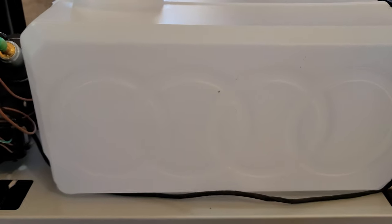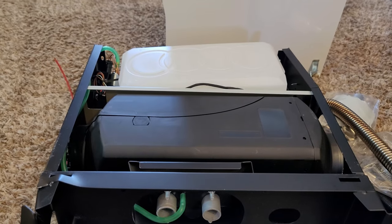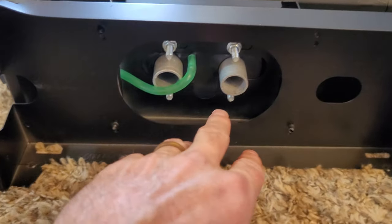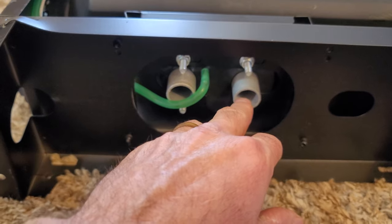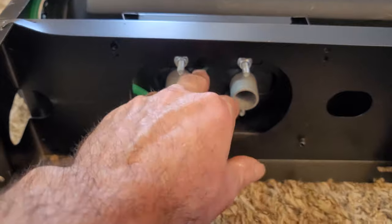This unit here is the heater part of it, and I'll have to read the instructions to see how everything gets hooked up. As you can see, I laid it on its side — you've got your exhaust and your intake air on the bottom, where your metal hose and your fresh air hose is going to hook up. You want to be sure you keep your exhaust hose away from the diesel line.